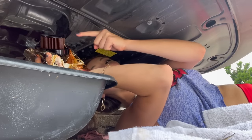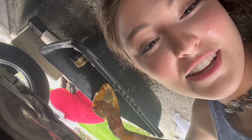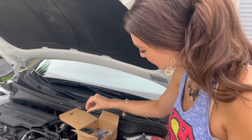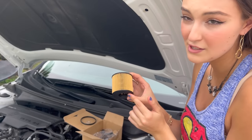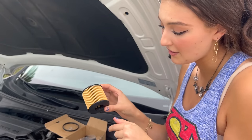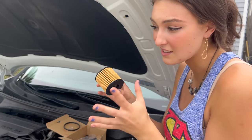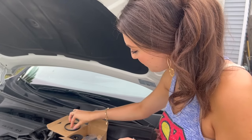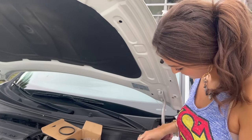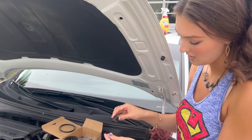The filter is off and now I need to clean my hand. We have a new gasket here and a new oil filter. This one is a little bit more of a hassle and messier, but the good thing is you can see exactly what's inside and it's a little bit less waste going to the environment. And then we have our new crush washer, so we're going to take the bolt, get rid of the old one, and put the new one on.